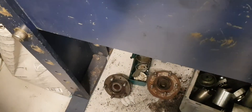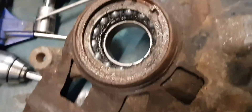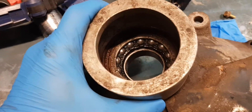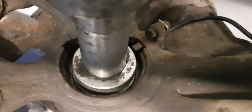We need to support the steering knuckle on the bottom and press out the flange. Then remove the retaining ring. Support the steering knuckle with a cylindrical tool bigger than the bearing, and press the wheel bearing out. Be careful not to damage the sensor.